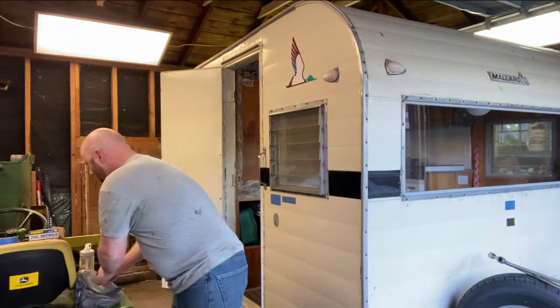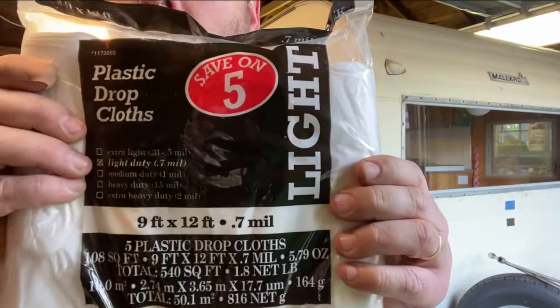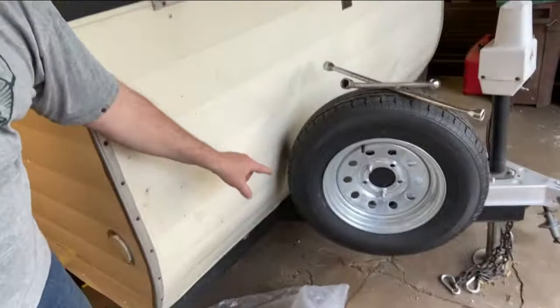What you want to do is get a paintbrush, spread it all on so there's an even coat over everything, and then cover it with a layer of thin plastic. I bought a plastic drop cloth, 0.7 mil at Lowe's — five bucks for all of it — and I'll cover a whole side with the Citrus Strip. Then press the plastic against it to seal it off so it doesn't dry out, and leave it overnight to see how it comes out. I'm also taping off the plastic lenses. On the front, I'm going to remove the spare tire and tape off the black frame because I don't want to take the paint off of that. All right, let's get to it.